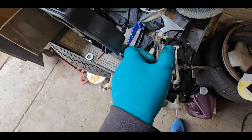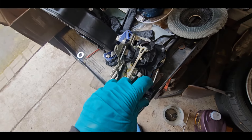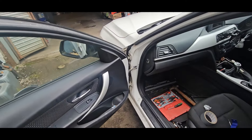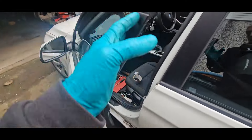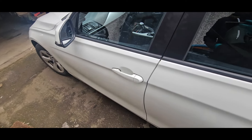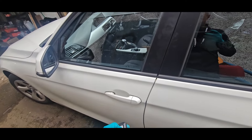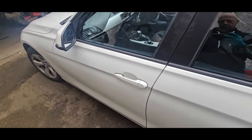So it's locked - push that down, open - there we go. A little bit fiddly to get the cable on for the exterior handle, and I managed to assemble it with the door handle wrong so it took the trim back off. Right, moment of truth - I've already checked that works. Why didn't it work the first time? Right, it all works anyway. Hope this has been useful.